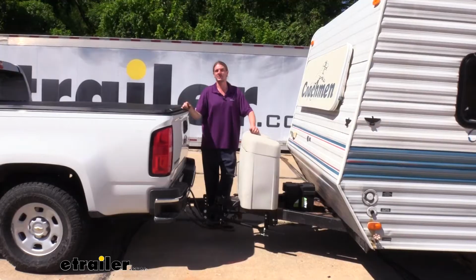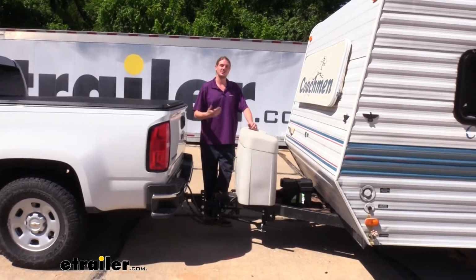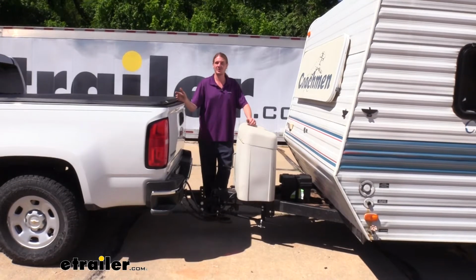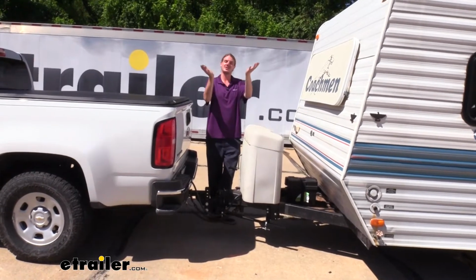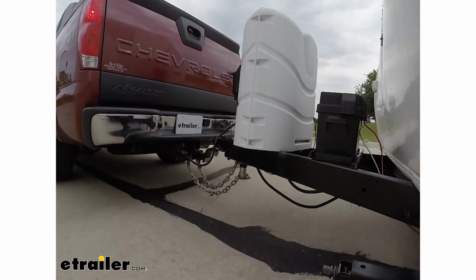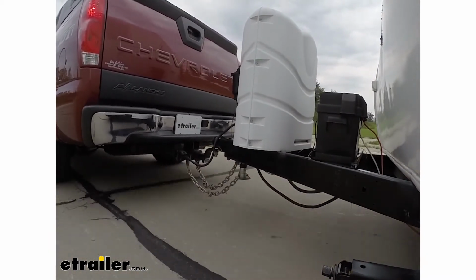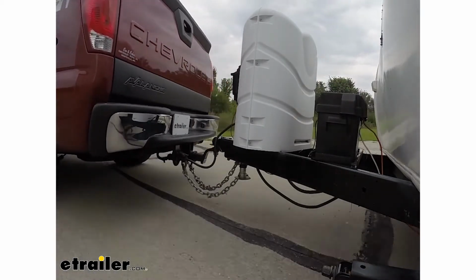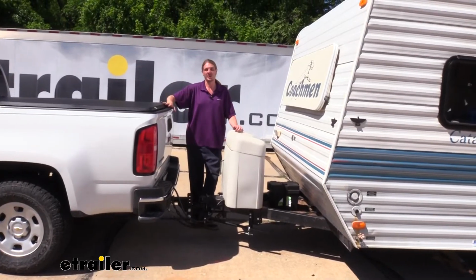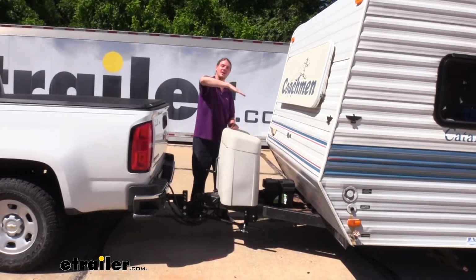This changes the geometry of your tires, which can cause excessive tire wear. It can reduce the handling performance of the vehicle because you have less contact between the surface area of the tires and the road. And that also affects your braking performance because the less surface area means less contact, and the weight's not being distributed properly because normally the front brakes do most of the work on your vehicle, and with the weight more on the back, it's not being able to go to that front axle.